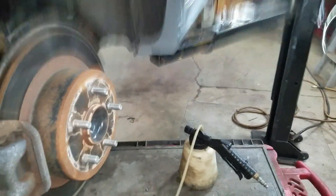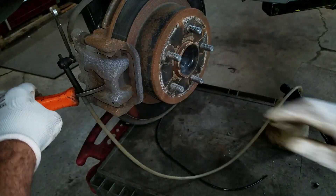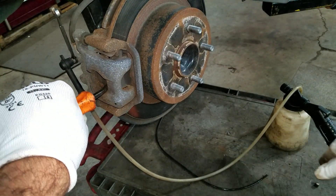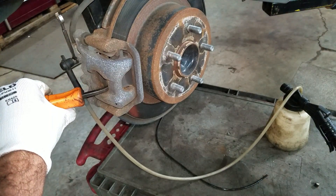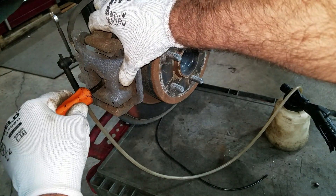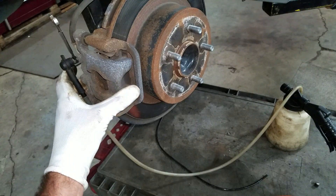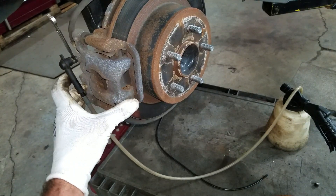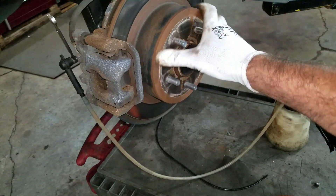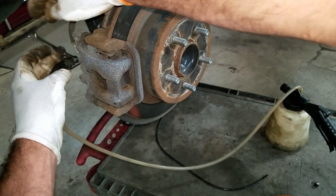That's just gonna go down into my brake reservoir. I'm just gonna get a pry bar — you can use a screwdriver — and lightly pull on this. I can actually see fluid going down the line. I pulled that out as far as I could, then I'm just gonna get behind the piston and push it in. It pushes in real easy. I can move this caliper real nice, so I don't have any caliper slide issues. I went around already and checked all these rotors — they turned really nice. I'm gonna close this bleeder now.